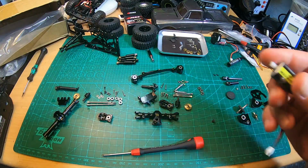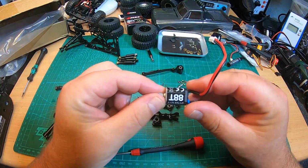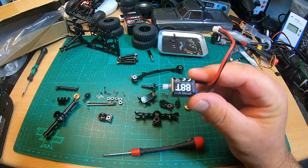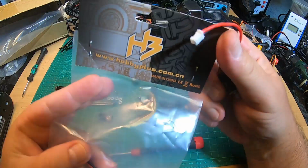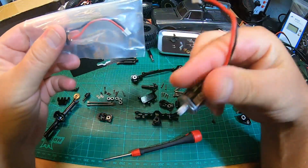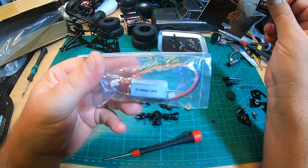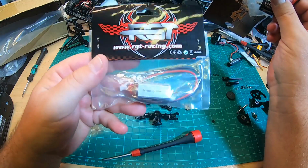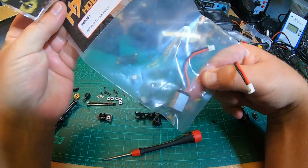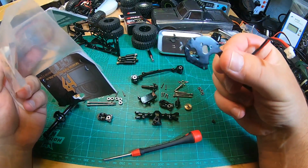Now I'm not sure, probably I'll make a stock chassis and even use for the test drives the original heavy high position battery mount, and we'll mount maybe the original SCX24 motor or one of those other same motors, 88 turn Hobby Plus torque motors, either this one or that one. And so no barrage motor, therefore I would have to cut the battery mount, the plate or the side arms. I don't want to do this yet, so I will probably use the stock, no, that's a Hobby Plus 88 turn tiny motor, and also use for the first tests the original plate and won't drill holes.